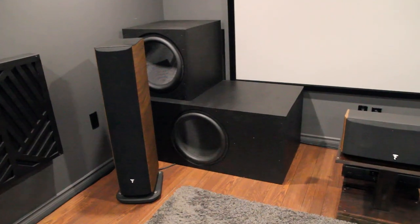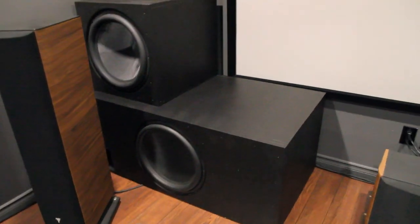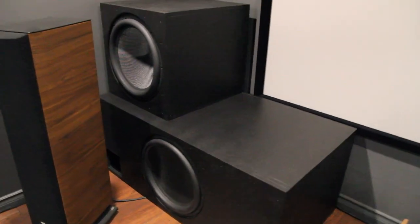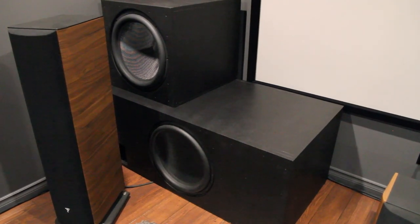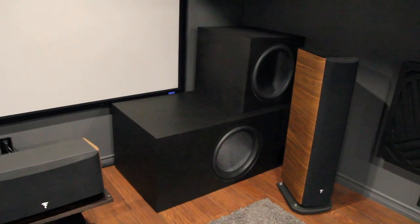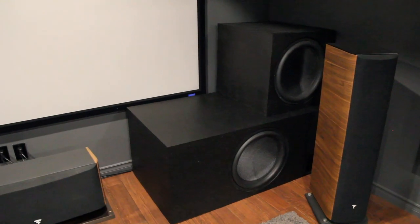Let me show you a few things — the subs, the amps, and the projector. All right, these are the subs — the new boxes made with the AZ Tuning design. They use a square port instead of the slot port used on the full Marty lineup, so the dimensions can be pretty much whatever you want. I just made it just enough to fit under my screen. I believe it's about 11 cubic feet tuned to 11 hertz. Then my original sealed subs on top — I've got the two ported laying down here. I tried standing them up in the corner but I didn't like the look of them towering over the focals, so that's the way I have them now.